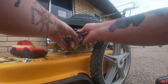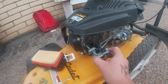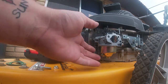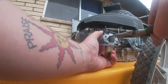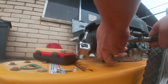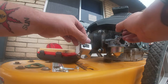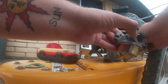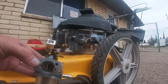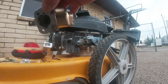The automatic choke is going to be a pain here. So we don't break this off, I'm going to show you a different way to take this off without unscrewing the whole back end. You're just going to take your pliers, open up the choke, grab the butterfly, and pull the butterfly out like so. Remember, this part goes back inwards. Now from there, we can just lift this up all the way out and put it aside.